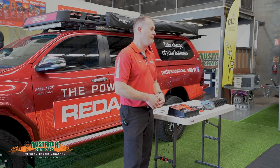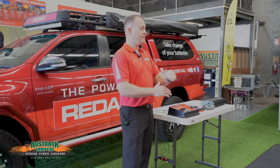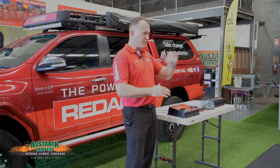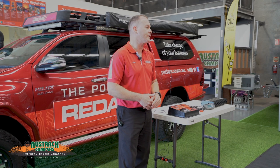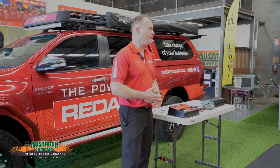With any battery, life is measured in cycles — from 100% down to 50% state of charge for a lead-acid based battery. With a good AGM battery you'll probably get about 1,000 cycles, which could equate to around 1,000 days of daily use before it's no longer holding charge well. If you're using your trailer every day, a lithium upgrade is definitely an advantage — plus the lightweight and faster charging make for a long list of advantages.